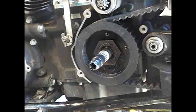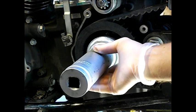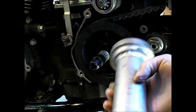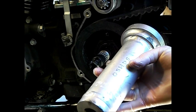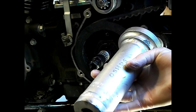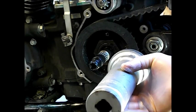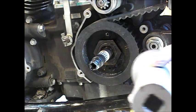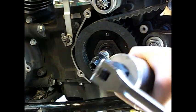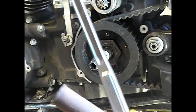I do happen to have the socket for this. This is a two-and-a-quarter-inch socket that fits on here and we'll take this off. This was generously lent to me by my friends at Ocean State Harley-Davidson. Barbara and Russ are the owners, as well as their daughter, in Warwick, but I'm working out of the Exeter store. Barbara was very gracious to me along with Keith in the parts department and Anthony in service, who spent some time talking about what I can expect and how to approach this. He said he's done it many times taking this nut off with nothing more than a half-inch breaker bar, a three-quarter-inch adapter, and some leverage. So I have an extra section of pipe that I'm going to put on the bar itself and kind of go for it.